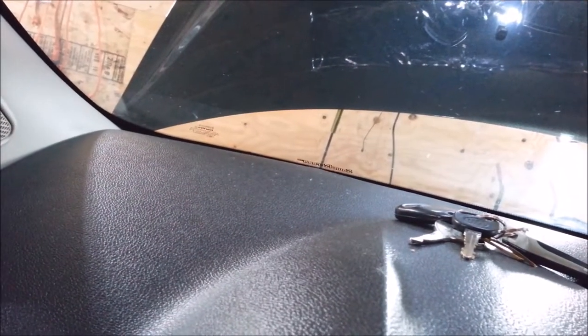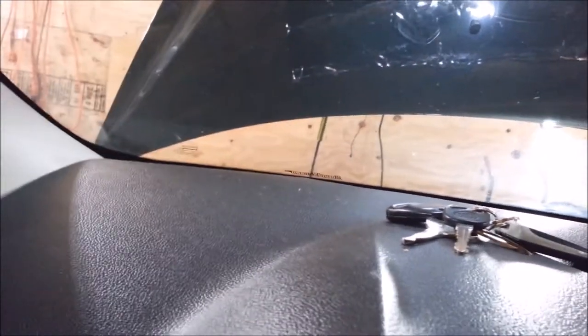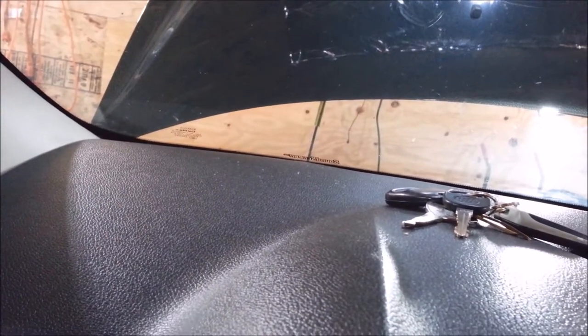I got this lovely piece of 2012 Ford Edge in here. I've been looking around on Google because of this problem and haven't found anything. The pedal goes down about halfway — the pedal height is kind of messed up. It's making a funny noise when I hit the pedal; it kind of sounds like fluid just passing through the master cylinder. I bled the brakes, got all brand new clean fluid in here, and the brake pedal height still sucks.